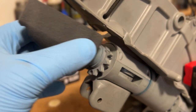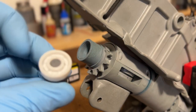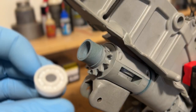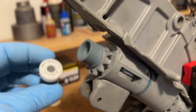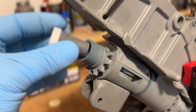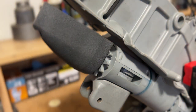Remove your rear cup, take it off, take your bearing out, and see how it's spinning. If it needs to be flushed out, go ahead and flush it out, put some light lube on it — it doesn't need much. These ceramic bearings are really, really good. Put it back in with light lube, whatever you want to do.